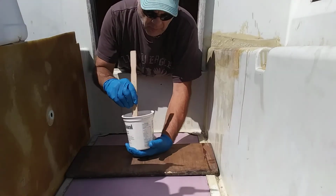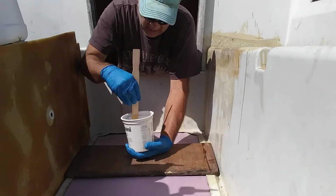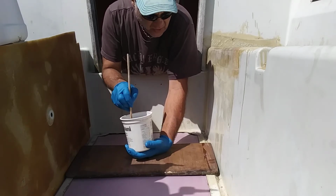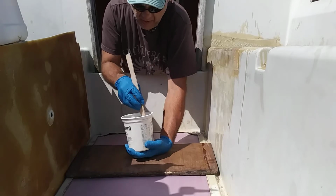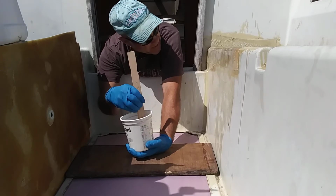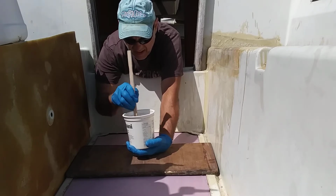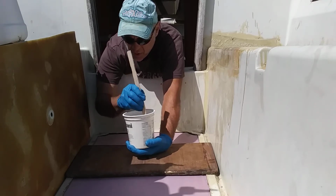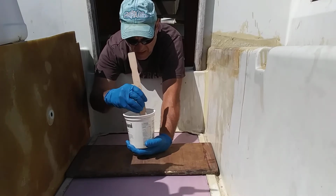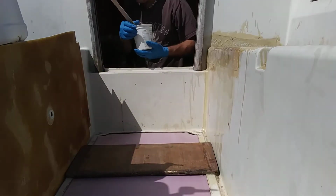But it's very important to mix your epoxy for 2 minutes, like they recommend. That way, you have nothing to worry about. At least you have less to worry about. There's always something to worry about with the boat, I guess. But anyway, I mix it over a minute and a half, let's put it that way. Pretty sure the more watery epoxy is, the quicker it mixes, but the warmer it is. All right, so that's mixed. Let's add the cabosil.